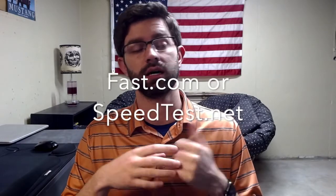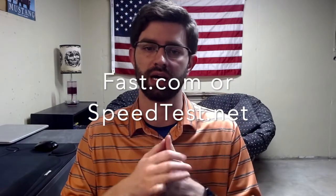For now, you can measure your network speed by going to one of these two websites, speedtest.net or fast.com. Be sure to measure in different rooms and on wired and wireless devices to ensure that you are getting the network that you need in the areas that you need it. So if you have a computer that you can plug into the router or the modem or a switch, go ahead and test it there through a wired connection.